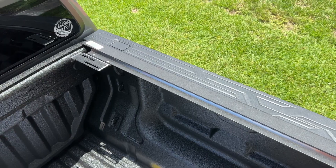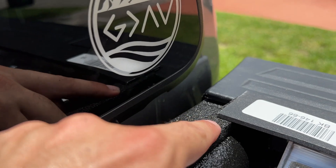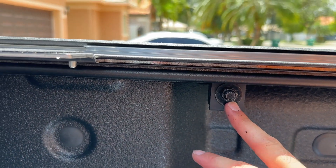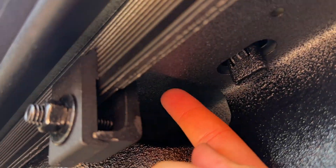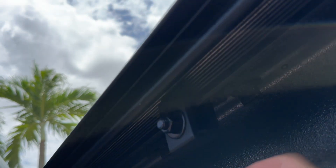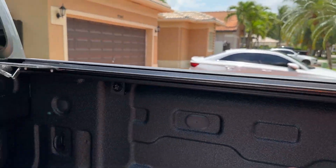On to the next step — the rails. You get your first bed rail, put it on, and slide it as forward as you can. It's got a foam pad here that seals it. The first clamp should be no more than 12 inches from the front. On the Colorado, there's a drop here that doesn't let you go all the way up, so I went right in front of that at about 11 inches. On the back, there's another drop, so I pushed the clamp right behind that. The middle one is a little lower but just under the maximum. It also says to torque it down to 10 foot-pounds — I got the torque wrench and did that. It says if you over-tighten it, you can warp the bed cap.